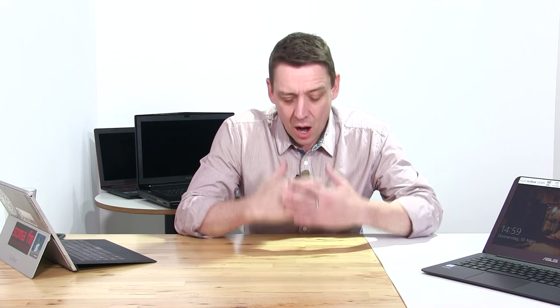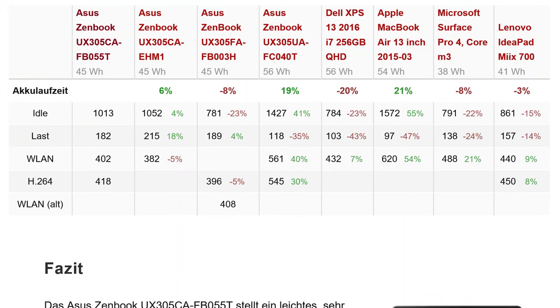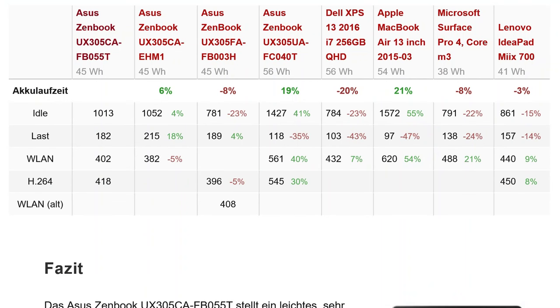One reason for the shorter battery life is the QHD screen. High-DPI screens don't have a lot of space to get light through — there's a lot of electronics and not much translucent material for the backlight, resulting in high LED backlight power. The UX305 doesn't idle below 3 watts with the screen on, whereas devices like the XPS 13 with a matte full HD non-touch screen idle under 2 watts. That extra 1 to 2 watt overhead is the trade-off for the QHD screen. Personally I'd prefer full HD to save that power, but if you need higher resolution, it's your call.